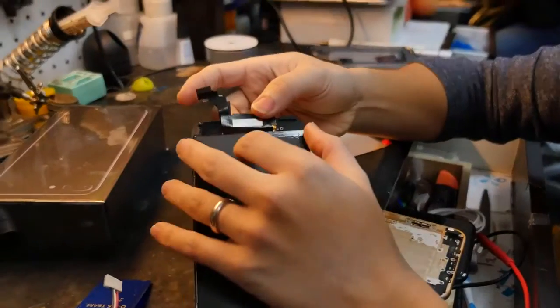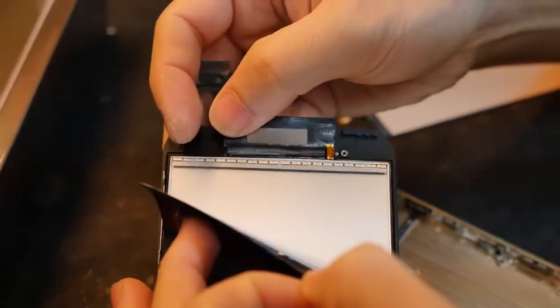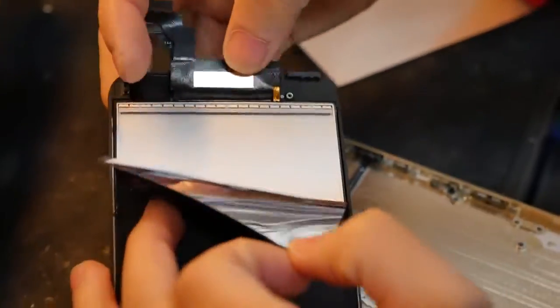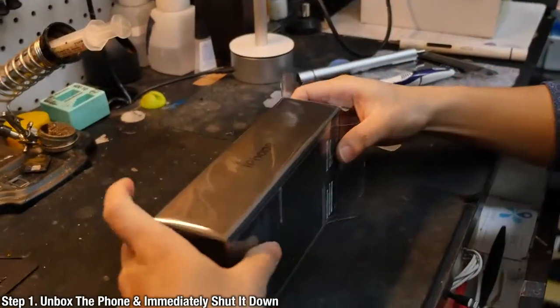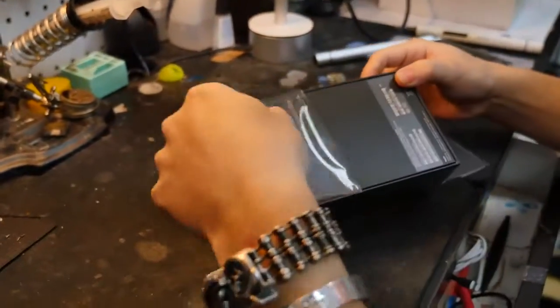So what you need is a 6S Plus clear logo. You can buy those online. And you need a broken used iPhone 6 or 6S LCD. And that's because we're actually going to be cutting up the LCD back TFT reflector as well as the LEDs. The LEDs are OEM and we're taking them straight from Apple LCD. So that means they're going to be very efficient.